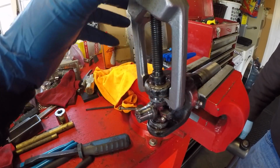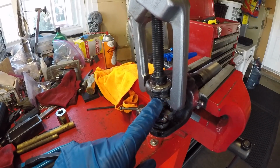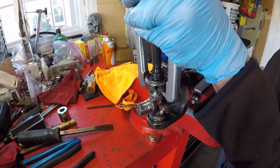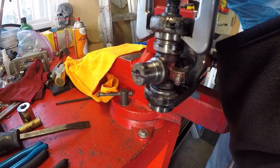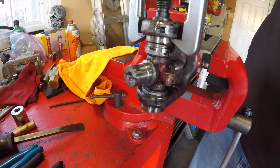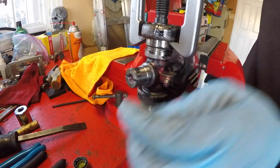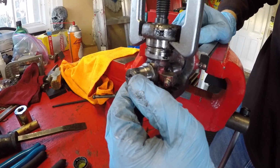We have the same setup again. We have the 2-jaw puller, and we're only going to drive this cup as far as we feel comfortable so we don't displace it out of the yoke. And we have movement. Let's not go too far now. Yep. We're taking a measurement, just seeing how much of that bearing cup is still in there. We can go another turn or so. Okay, let's stop here, and now we can use our previous trick.